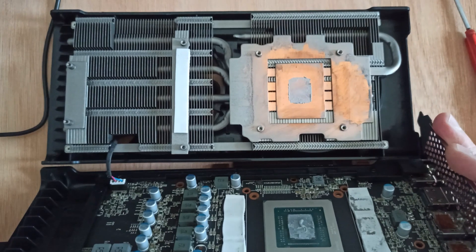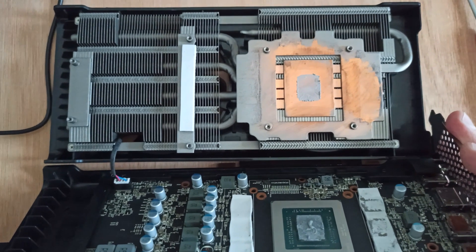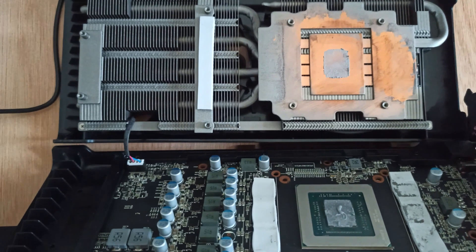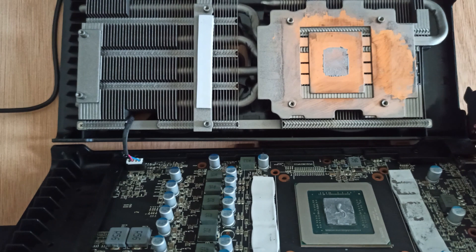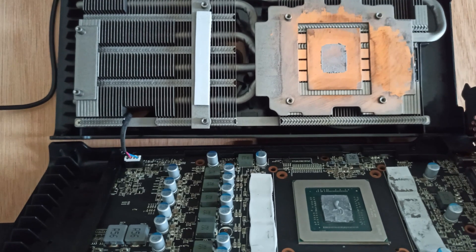Here it's all plugged back together again. Three wires into a four-pin connector — it's connected. There's a little hole in the heatsink it should have passed through; I missed that again when reassembling it. You really do have to get the wires the correct length, otherwise they're going to get folded in half, caught somewhere, snagged — probably not melted, but they'll interfere with heat flow at least.